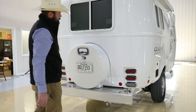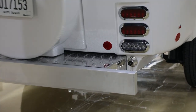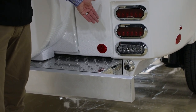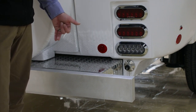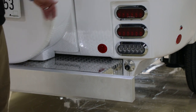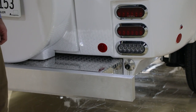Over here on the right, underneath your lights, you'll notice another water inlet — that's the rear inlet that works for the boondock and winterization configuration. You would simply hook a short, roughly two-foot-long hose into that, and put the other end into either your antifreeze, fresh water, or whatever liquid you are trying to pull inside the camper. Once attached, you'd go inside and turn the water pump on once the valves are set to the proper configuration.